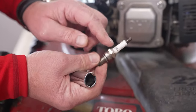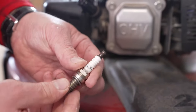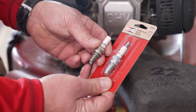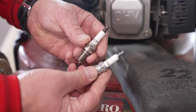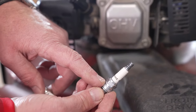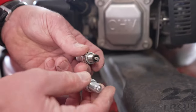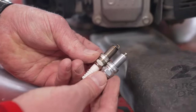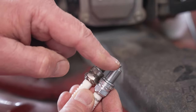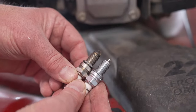Now this is the Kohler number because it's a Kohler engine, and when I cross-referenced that, it came up with this Champion spark plug. Interestingly enough, what I noticed — because I took another one out of the package — is this used an 11/16ths socket, but the new retrofit one is actually going to use a 5/8ths socket. I don't want you to be too concerned with that sizing. What's most important is when you hold the spark plugs next to each other and line up these washers — this is the most important part — the depth of the actual spark of the spark plug. When I hold them there, you can see that those line up and match.